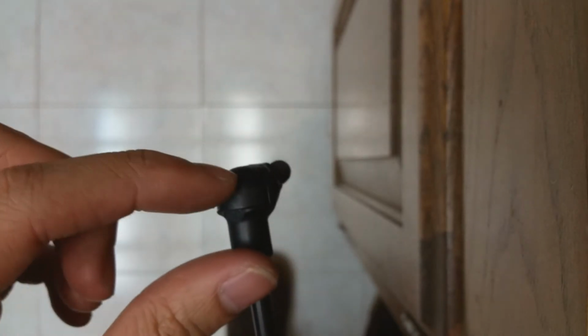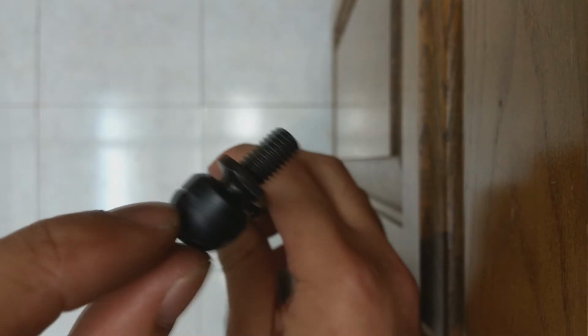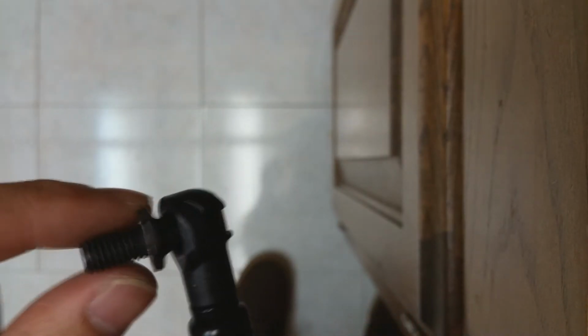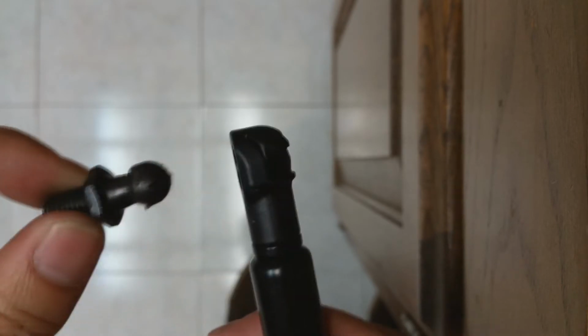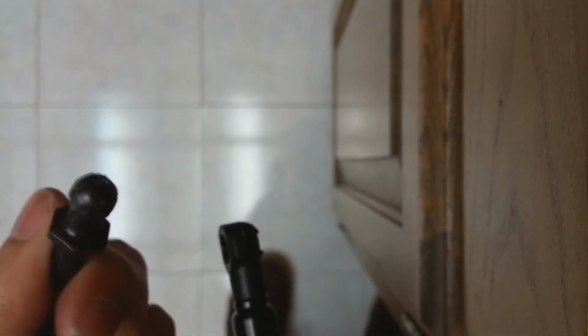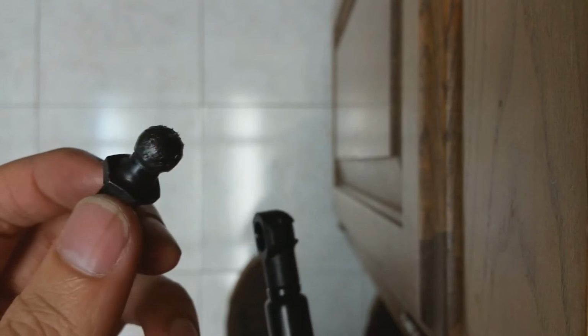It was pretty dark outside, and I wanted to show you guys the metal retainer band on each end of the strut. You can see it right there wrapped around, and at the end of the strut there are two slivers to where you can slide it back in after you've removed it. On the other side, I've already removed it. What the band does essentially is apply pressure to keep the ball joint in place, so without the band around it, this thing slips right out. This came as part of the packaging. I assume it prevents the grease from drying up.